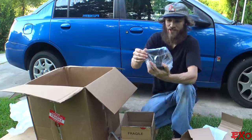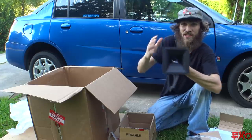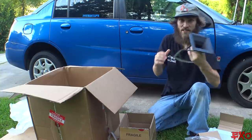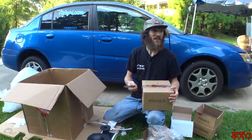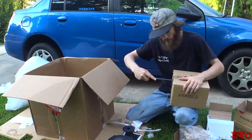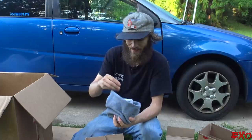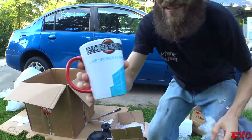Here's the horn for the compression driver. Perfect size — a nice aluminum waveguide for our horns. This is going to project the sound out and actually amplify the sound coming from our one-inch throat. It's not just for looks or to spread it out — it actually makes it louder. We're going to have a nice, aggressive sound keeping up with the bass at 160 decibels. You really can't expect an ordinary silk dome tweeter to keep up with that madness, so that's why we've stepped things up to compression drivers. These are known for their efficiency — over 105, I think 108 dB efficient. And hey, we also got some swag — B&C sent me over a little mug.